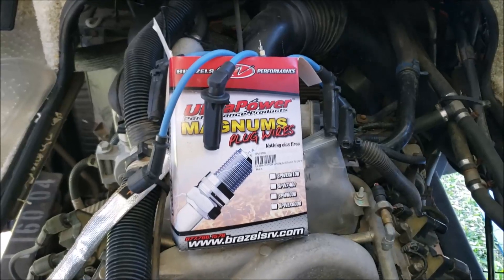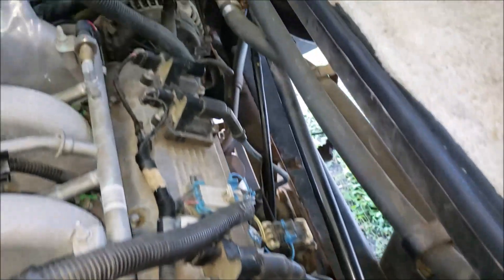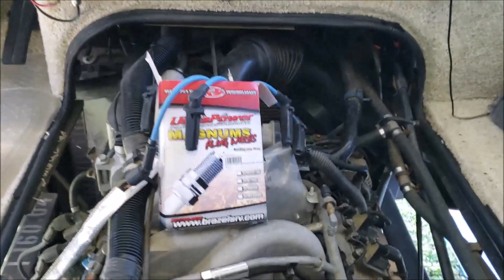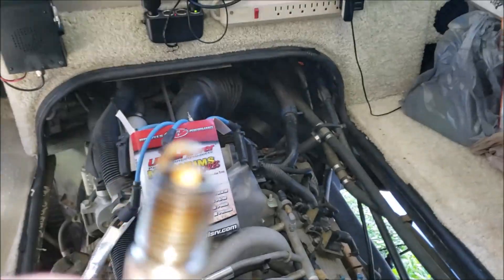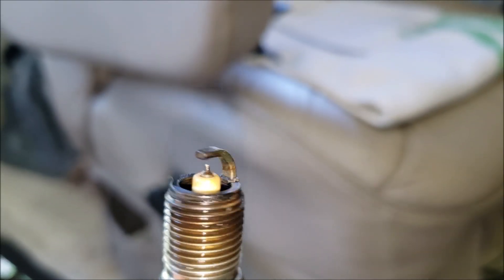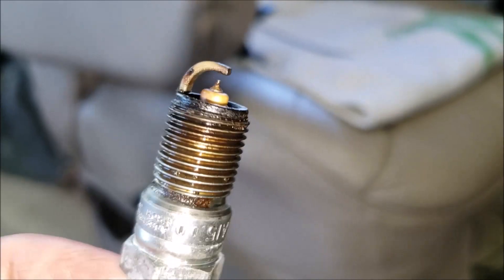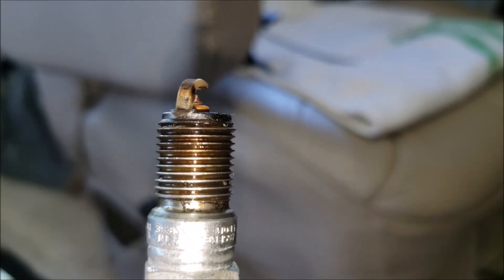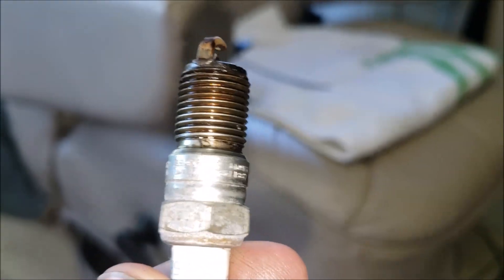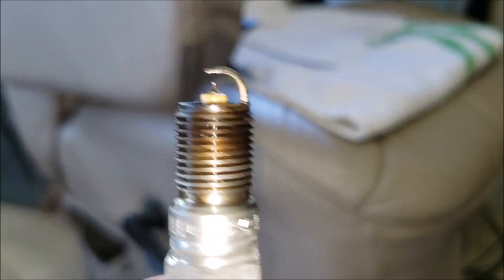It's the next day and I'm about to put my plug wires on. I've got the W24 chassis so I've got quite a bit of space. Depending on your chassis, it might be easier to do it from above or below — I'll probably go below. Before I started I was curious, so I went ahead and pulled out one spark plug because I put these plugs in 8,000 miles back. I always like to spot-check my plugs to see how the engine is running — it looks really good. I did not use any anti-seize and they came out really easy. Spark plug manufacturers these days don't recommend anti-seize since the plugs already have a coating on the threads to protect them.